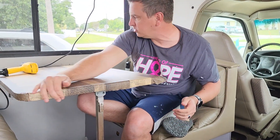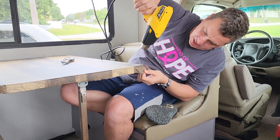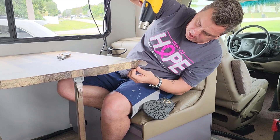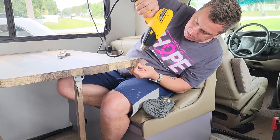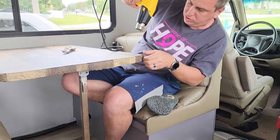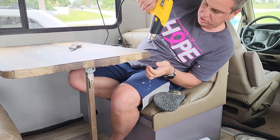On the curved sections, it's more of a soft angle rather than a straight one. Set the heat gun on a low-hot setting and heat the vinyl — you'll see it start to stretch a little. Don't put it too hot because you'll melt a hole in the vinyl; I've made that mistake. Cut the strip so that when you fold it to the other side it overlaps slightly with the piece coming from the other direction.